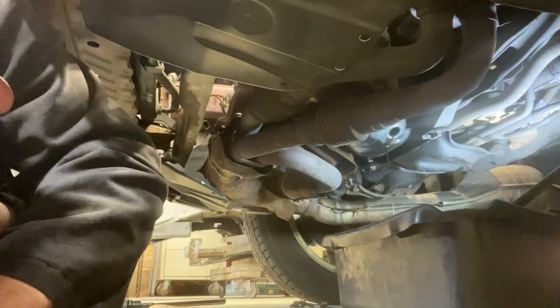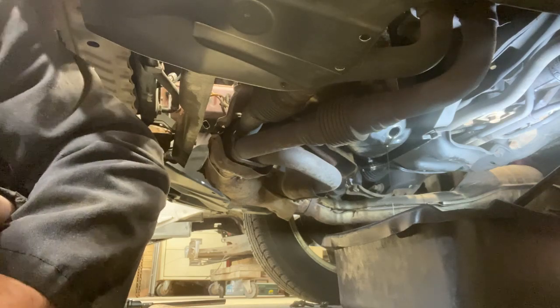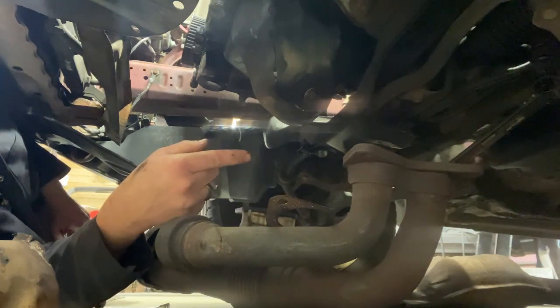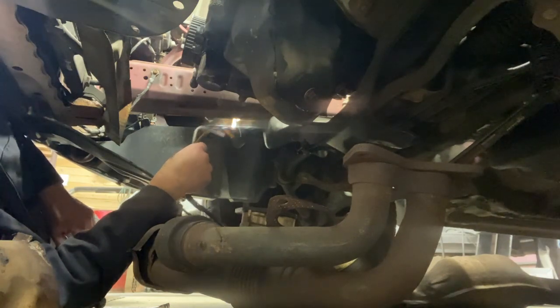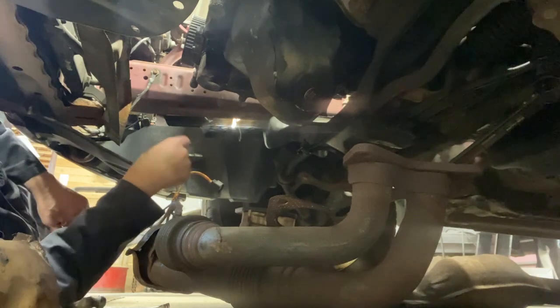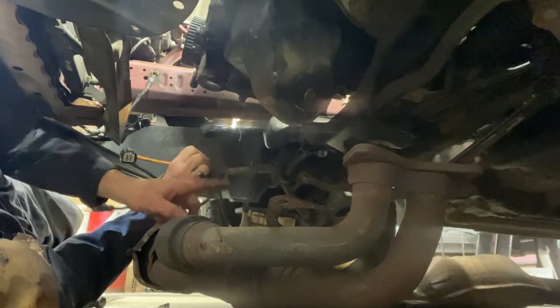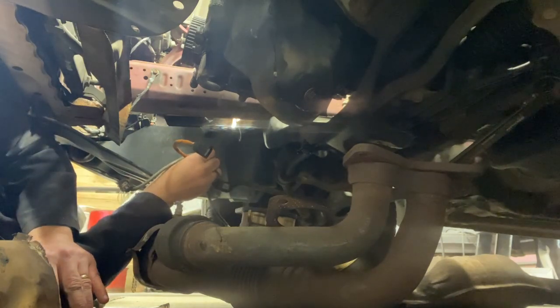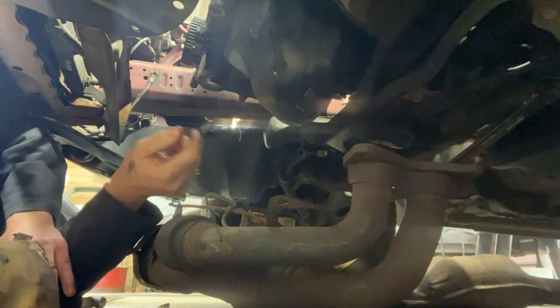All right, I'm gonna take a look and see whether I can unbolt a couple exhaust mounts and lower it down. I don't know if that's possible or not. Well, in case you're wondering, if you unbolt the 14 millimeter at the point just behind the transmission, it will break off, and then you have to take off the two 12 millimeters that hold the bracket on, and then you'll realize that it's pretty close to hanging on the oxygen sensor wires. In actuality, it was hanging on this plastic thing, so I unbolted the bracket right here, which is hard for you to see. Right here. That goes on the bottom side of the passenger head, which frees the oxygen sensors. And then the whole thing drops to the ground. So now I've got pretty easy access to the oil pan.